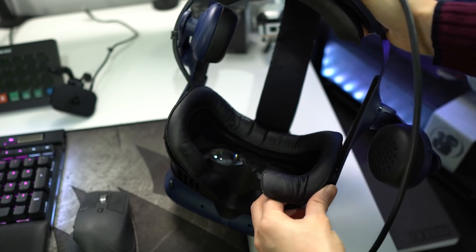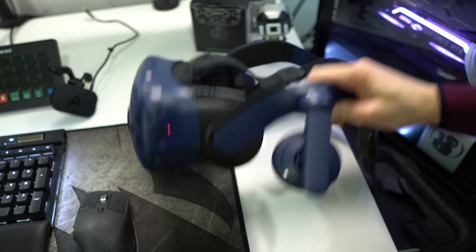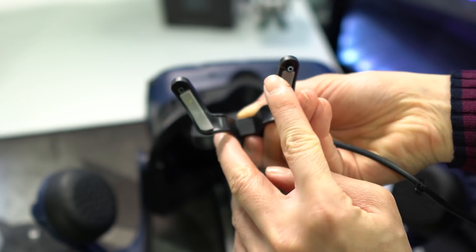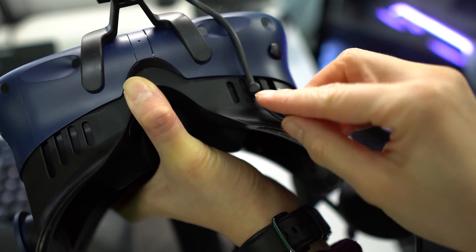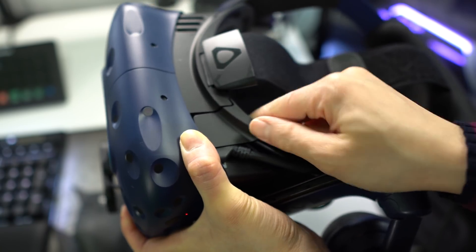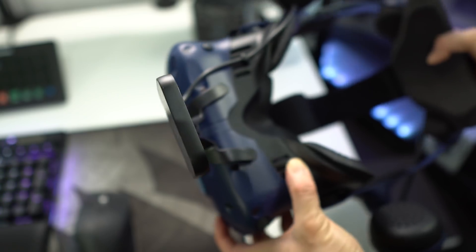Before we move to the fun stuff, let me show you how to put it on the headset. Remove the face cushion first, then the compartment cover where the cables go in. Turn the headset around and grab the facial tracker. It will have some protection on the double-sided tape, which I removed already. Align these cylinders with the holes at the bottom of the headset — make sure it's nice and tight — then using a provided clip, you can attach it to the ventilator grates. Loop the cable and connect it to the USB-C slot on the headset. Reattach the cover and face cushion. Last, install the tracker software at Vive.com and it should work immediately. If you want, you can also use a screwdriver to reposition the tracker a little.